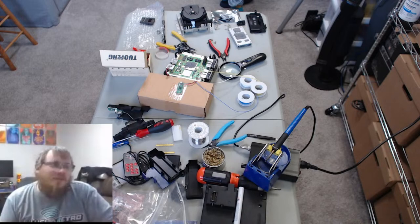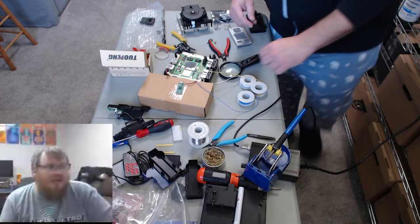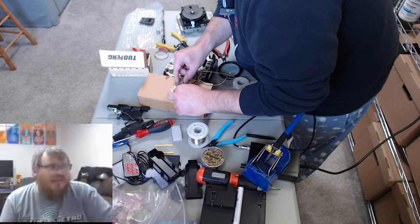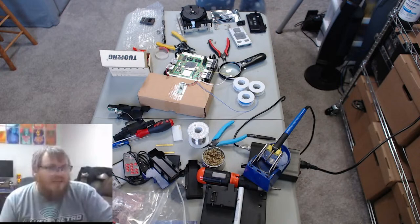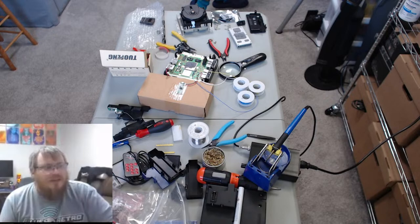reversed. The original Xbox will likely not get support from Blue Retro, because the original Xbox uses USB controllers, and Blue Retro is not capable of direct USB output. There has been some talk about doing a kind of USB addition to Blue Retro as a separate project that uses a different version of Blue Retro that can talk via a serial port to an adapter that can then talk to the Xbox.